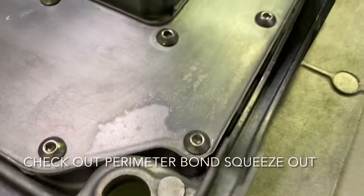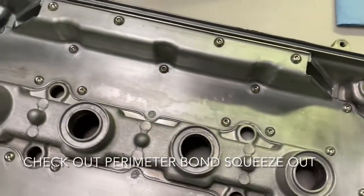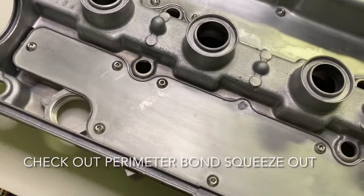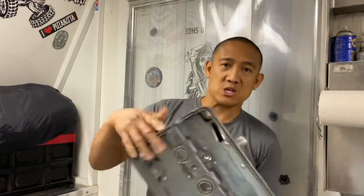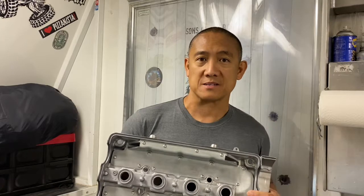Check out this baffle — it's completely finished. You can see all the M5 screws are in now. Keep in mind those are all attached with blue Loctite. As a recap: if you're planning on welding aluminum bungs onto your valve cover, make sure you don't forget to remove your baffles so you can clean all of the aluminum chips that came from drilling. Thanks for watching — if you have any questions, leave them in the comments, and please like, follow, and subscribe. This is AJ with Relentless Racing — stay relentless and I'll see you on the track.